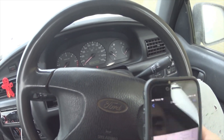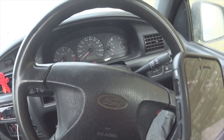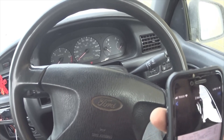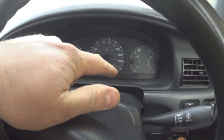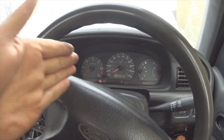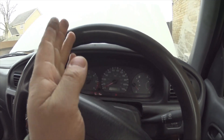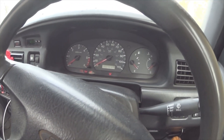I'll put a page up of all these codes at the end of the video. I hope you can sort your Ranger out — they're not hard. Just need a bit of wire or a paper clip to keep flashing those codes. It's basically morse code: a long flash for the start of the number, then however many flashes is the digit, then a long flash separating each digit. There are only about 20 codes in total.